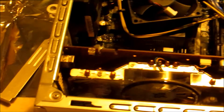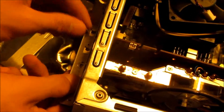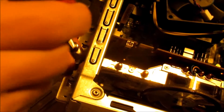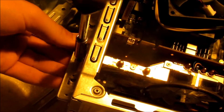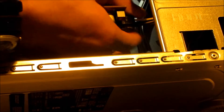Whatever was holding this on — some of them have individual screws to hold these on. This one just happened to have one thing that holds them all on together, which I don't really like, because when you take it off the other ones become loose and could fall off. Just screw that in there. Now take this cable that you had before, and you're going to want to plug it in — if yours does take a PCI slot, just plug that in to wherever it goes.